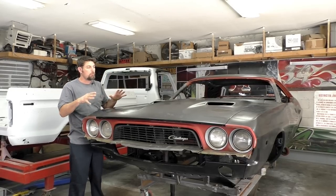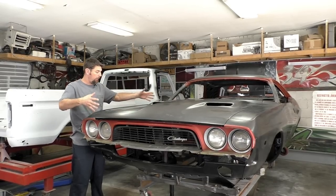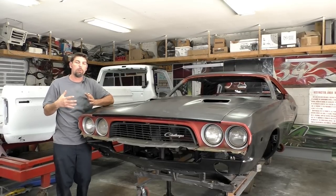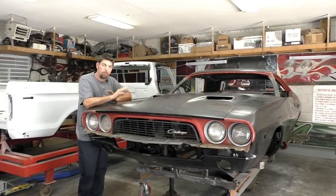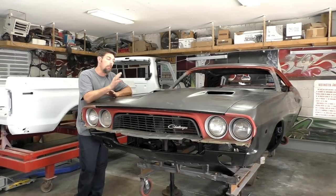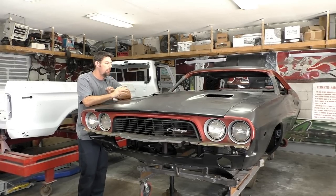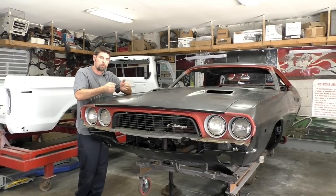On this video, we really plan on taking the car from a state that looks like this to this. We have the whole AMD front end installed, all the sheet metal test fit into place. I did this because we had some adjustments to do - we don't want to start welding and then find out the fender's not even close to fitting. We also test fit the grill with the owner - everything fits really good. We're also going to verify our fit up and go over camber and caster stuff, especially on these E-body cars. It's hard to get caster in them. I'll show you what caster is and how you can get more caster in these cars if they're not welded up.